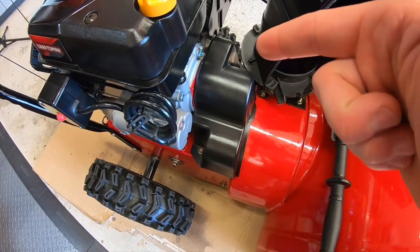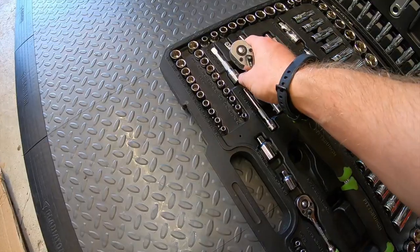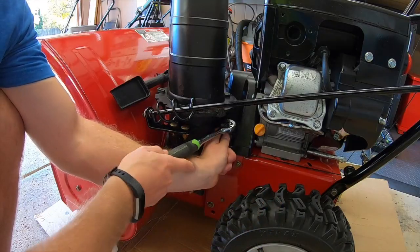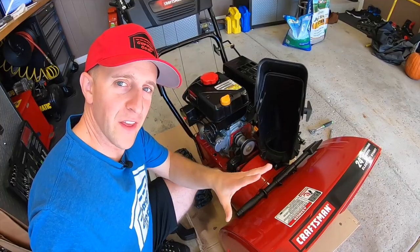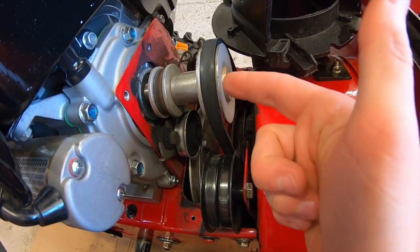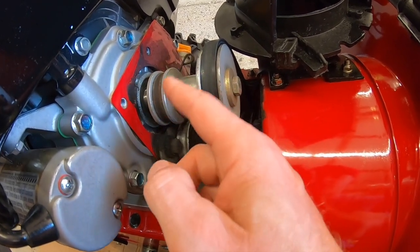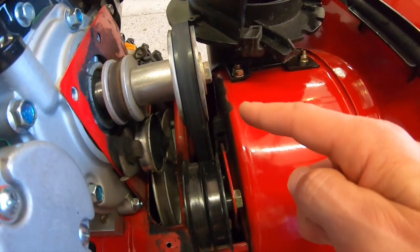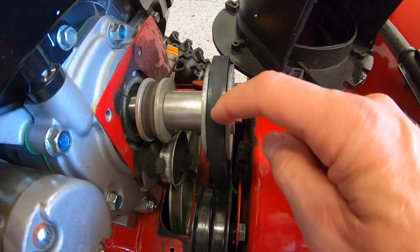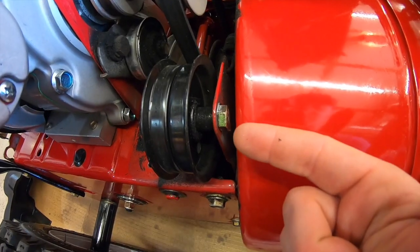When I was there I told him I wanted to take a look underneath the cover and check the belts. The cover comes off — and once again I was shocked. Usually under a belt cover, as the belts wear you get black dust all over the surrounding metal. There's a little bit here, but that's nothing. Even on the other side, very little. This whole thing is clean. The belts look terrific and they're in great shape. I do need to tighten them up a little bit — this tensioner is set really low.